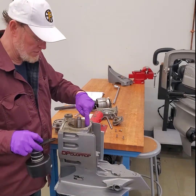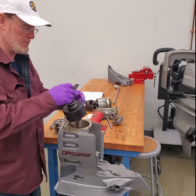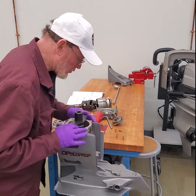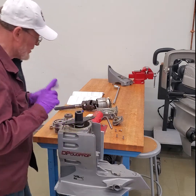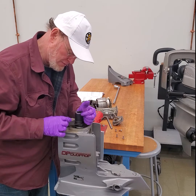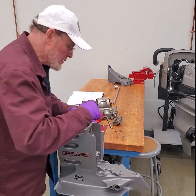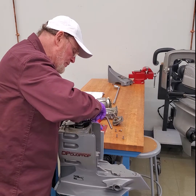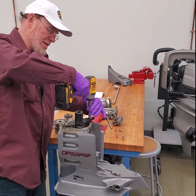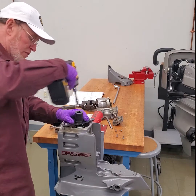This tool goes into the housing and there's a very thin aluminum retainer that's threaded in the housing — this is critical. When you put this inside the case, the book will tell you to line the bolt holes up as best you can one way. Take two of the top cover bolts, push down on the retainer. Put the top cover bolts in and get them started by hand. I'm going to use my impact gun — I don't recommend you do this, but if you're going to, make sure you use it lightly.